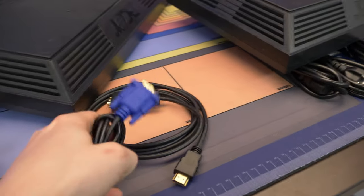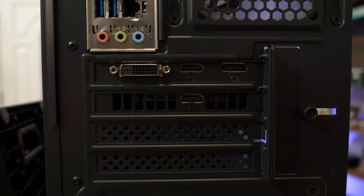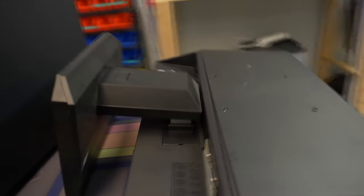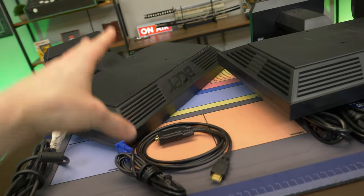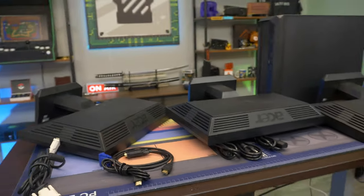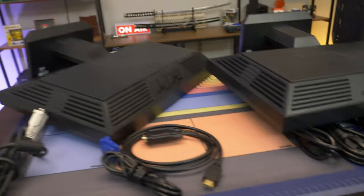Just to recap, we're going to be using two VGA to HDMI cables because on the back of our card we have exactly two open HDMI ports, which leaves only a DVI and a DisplayPort. For the third monitor, we're going to be using DVI to DVI because one of our monitors luckily has both DVI and VGA. This is really one of the biggest battles with triple and dual monitor setups — you have to make sure you have the right adapters going the right way. I will have affiliate links in the description below for every adapter you could possibly need.